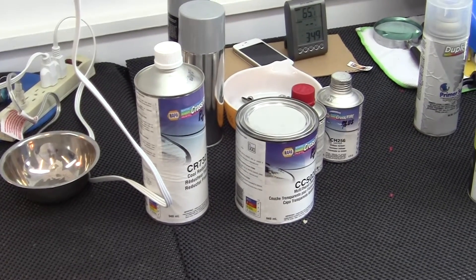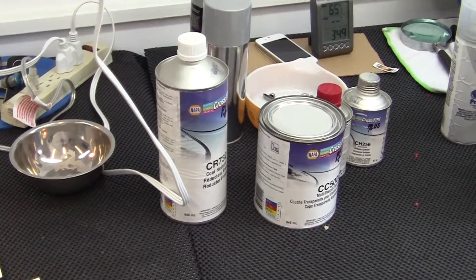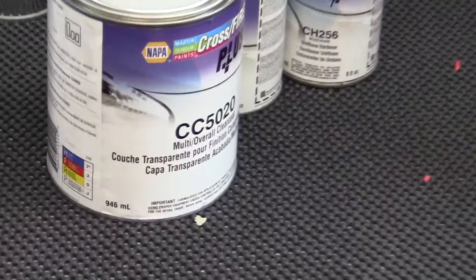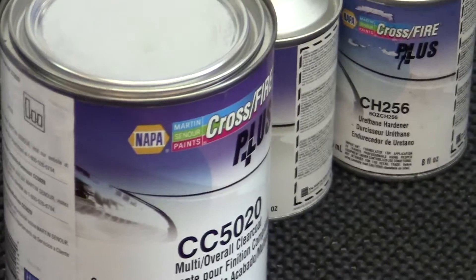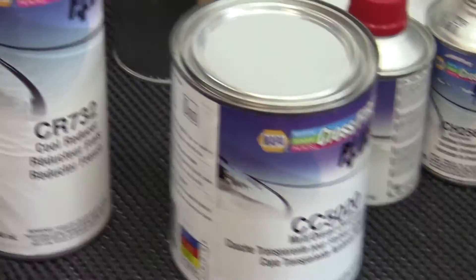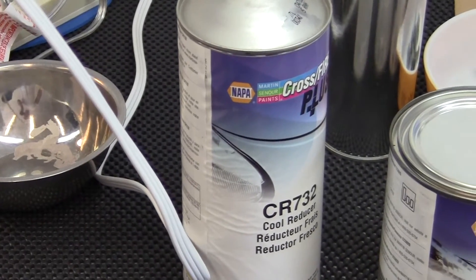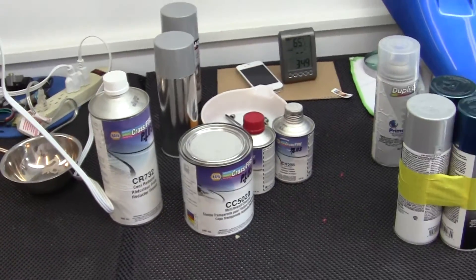What I decided to do was get my color right and then seal it with a high-performance clear, which is three parts. Since it is enamel — which most cars are, some type of acrylic enamel — I have the acrylic enamel clear right here. Acrylic means hard, so it's hard enamel. I have the reducer — you can call it reducer or thinner, but for enamel it's called reducer. And it has a hardener, so instead of the clear hardening in three weeks, it will harden in six hours.